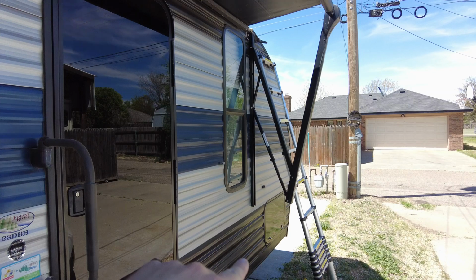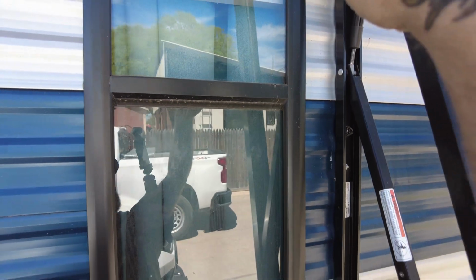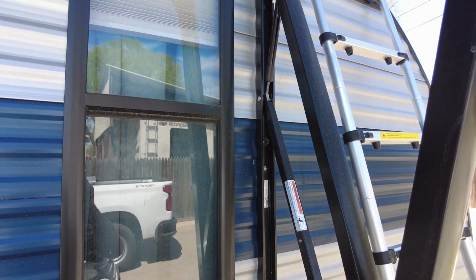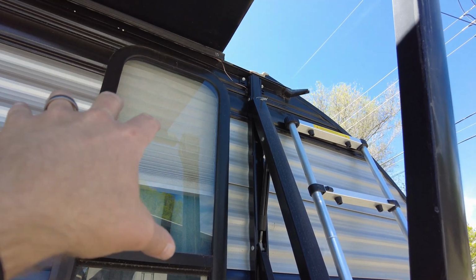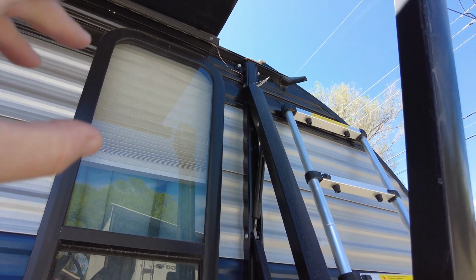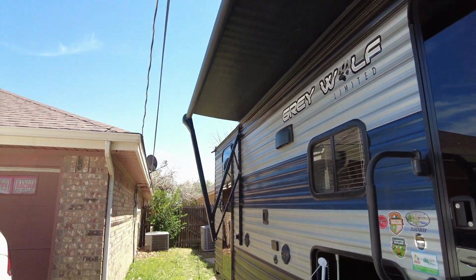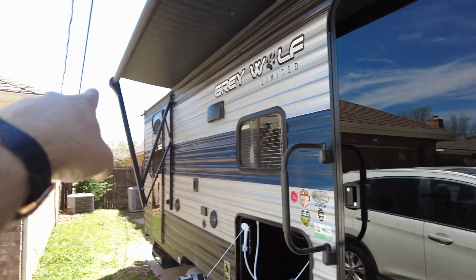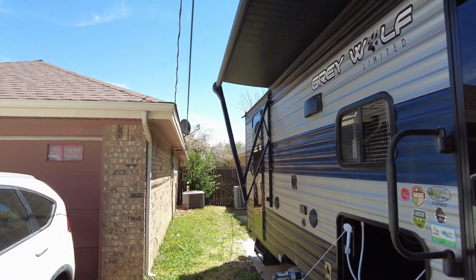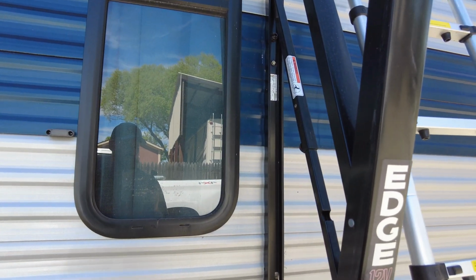I've got the awning extended a few feet, because we have to access this nut here, or bolt, lag screw, whatever they're called, this one, and then there's two up there. We've also got some power for the lights that looks like I'm going to have to just cut because it's sealed, but we can splice into that later on, no big deal. So the plan is we have to get these ones down here undone on both arms, so that then we can put the awning back in, and then there's two more screws up in the top there. We can undo those and I can get this whole thing slid out from the track safely, hopefully. So anyways, I'm going to work on getting those undone and we'll come back.